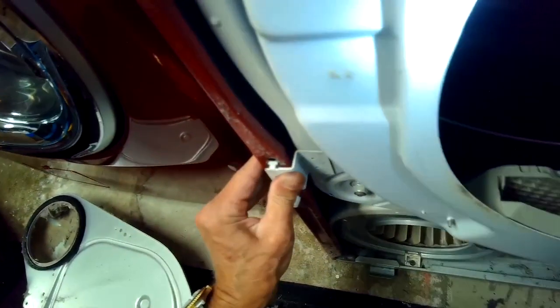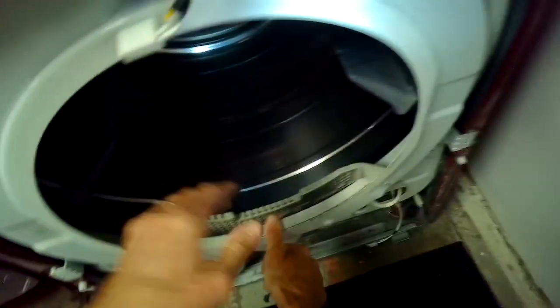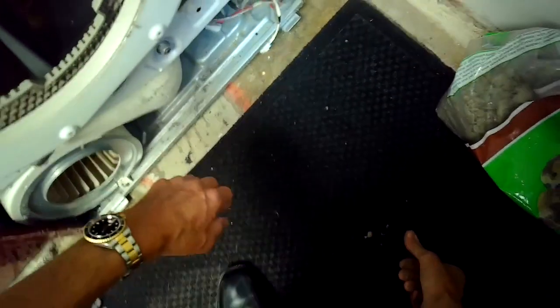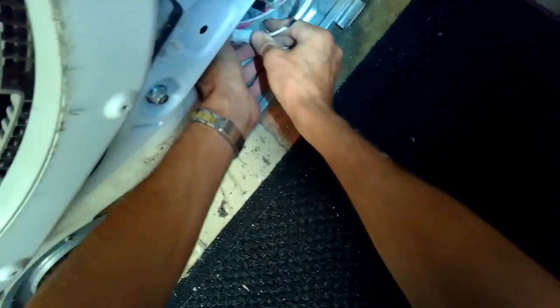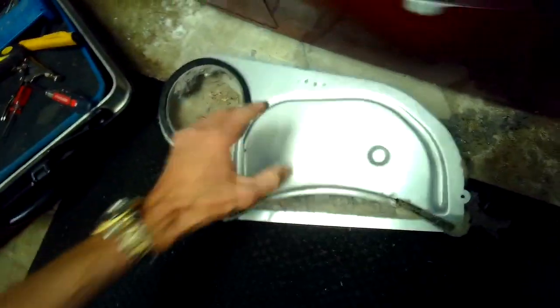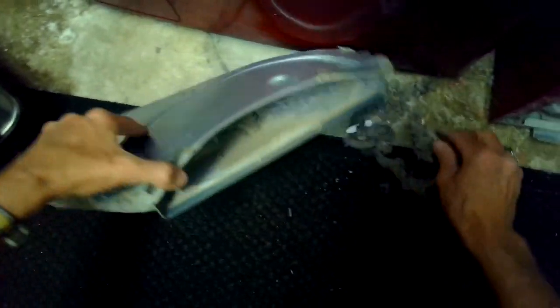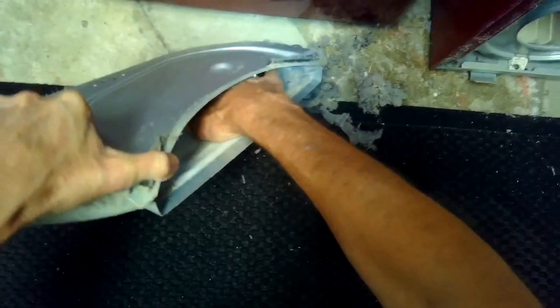There we go. Another thing that could cause rumbling though is the blower fan. It's in the lower left hand corner. If it comes loose of the motor shaft, the way you know that rumbling is coming from that is if you open the door while it's running, you hear the rumbling. When you open the door, the motor stops, but then the rumbling will continue sometimes for a full second. And that means that that blower fan is still spinning. It should stop immediately, but if it's come loose, it'll keep spinning, it'll rumble. Then you just need a new blower fan.